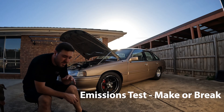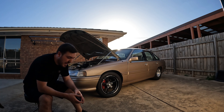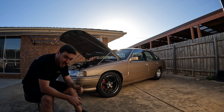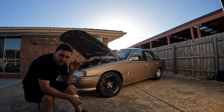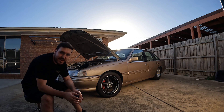Now we're moving on to emissions - this is where I had to pay quite a bit. Three tests down at Vipec, a facility in Port Melbourne. The engineer is going to say we need to make sure it's meeting current emissions. You're going to need the five-gas test or the IM240 test - have a look into that. I believe it's ADR 37/00 - ADR 37 double zero is the emissions guideline your car will have to meet. To make things simple for you, because I did fail this three times.